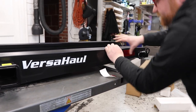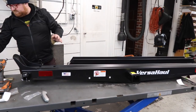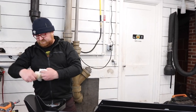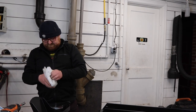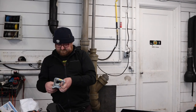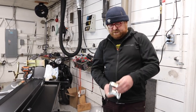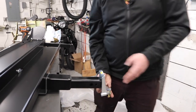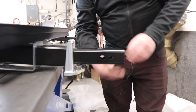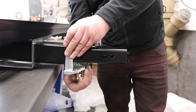There's pretty much one part left, but this part does not mount to the kit — it is for use when you're actually mounting this onto your hitch. That is the anti-tilt bracket. When you have your hitch on here, imagine the vehicle is hooked up to it. Put this on so you have the three bolts towards the actual hitch of the vehicle, then tighten these down.